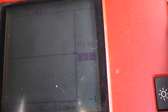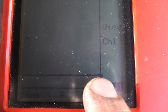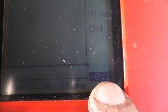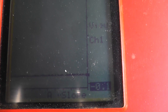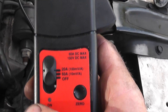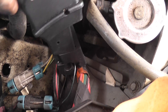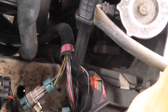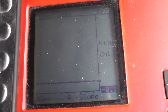Generally I like my bottom line to be not at zero — I want my line to be just above the bottom of the screen, which is negative 100 millivolts, or in our case negative 1 amp. Using my amp probe set on a 20 amp scale — again the conversion is 100 millivolts per amp — I'm going to clip that over my blue wire. I have my little remote here and we're going to crank it. We'll probably have to change our time base and scales a little bit.